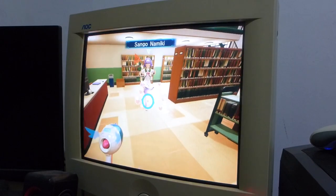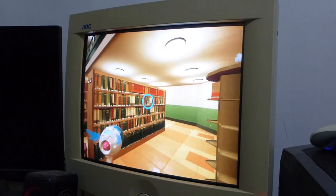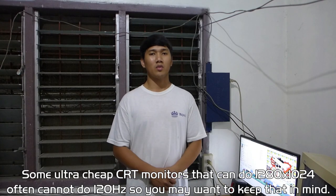I suppose this is enough for gaming at 120Hz on a CRT monitor at twice the resolution compared to my old video. I hope you found this video informative in regards to trying to get more life out of these old glass tubes. As long as the monitor supports 1280x1024, it should be possible to run the video mode demonstrated in this video. This is also pretty much the cheapest way to experience 120Hz gaming, because 120Hz and 144Hz monitors are often very expensive, and you can get one of these CRT monitors for cheap or even free from recyclers or friends and relatives.